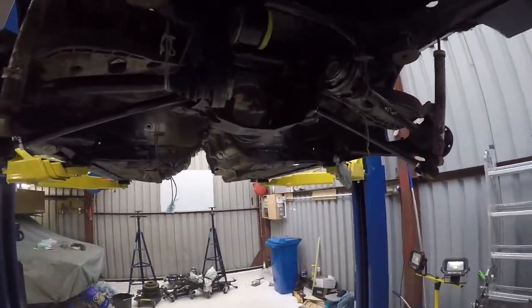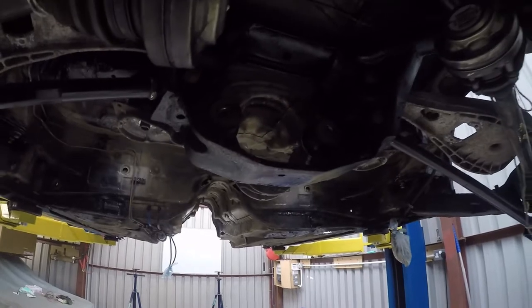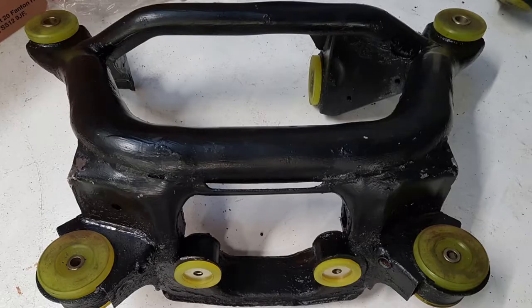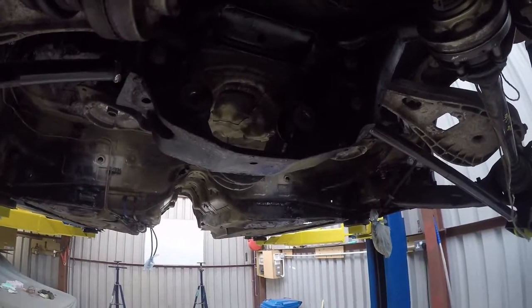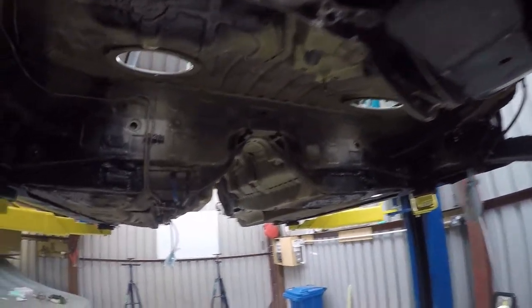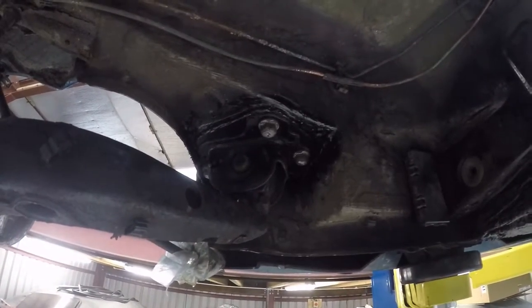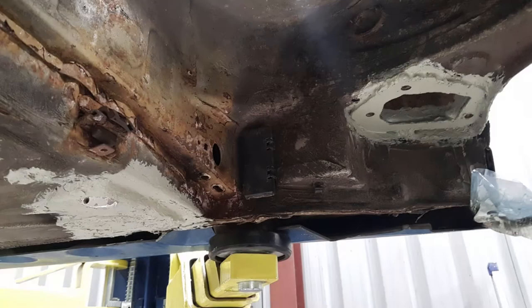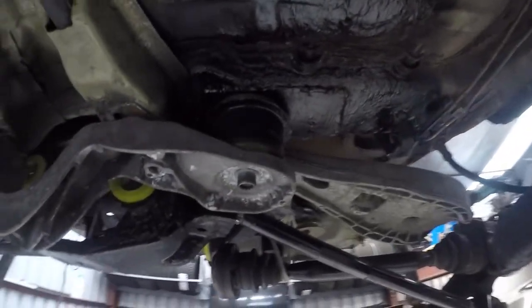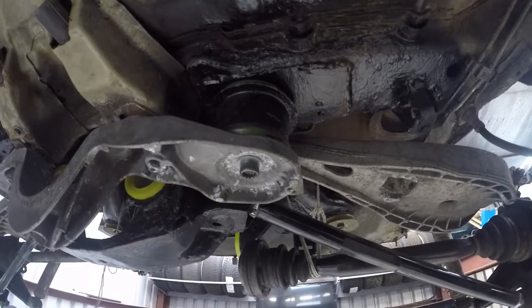So I'm just going to start by walking you around — I thought we'd start underneath. In terms of where we're at, the rear subframe's back in now. It's all been polybushed. All the subframe mounts have been reinforced at the bottom and the top — I'll explain the top later. The rear trailing arm mounts have been reinforced with 3mm plate, and the rear subframe mounts have also been reinforced with 3mm plate, front and rear.